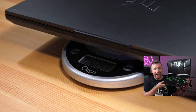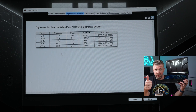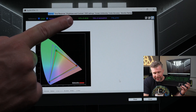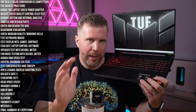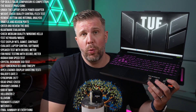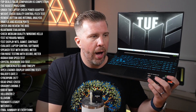We also had 430 nits brightness on that display — that's excellent. The only downside is color gamut: 100% sRGB but only about 84% DCI-P3. So if you're after video editing or graphic design, it's not going to be as colorful as more expensive laptop displays. There are some cheaper laptops with better quality displays, but those laptops won't have the same CPU performance. I went over five different competitors in the full live stream, so check out those competitive options there.